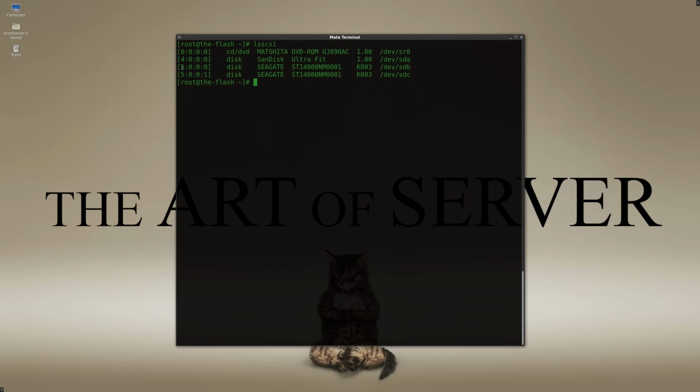So, oh yeah, look over here. If you look at the SCSI address, you see the 0 and the 1. So that's the LUN number. And so, you know what? Let's take a look at the logs, and we can dive into that a little bit more. But that's good news, though. That means that even if you are using these drives in a single port system, not a dual port type of system, it's still going to work. So that's actually really great.